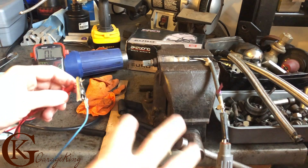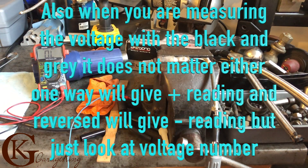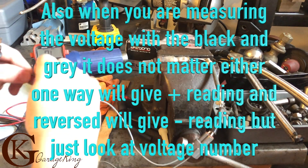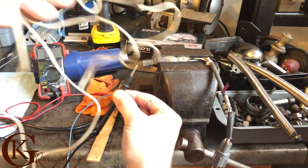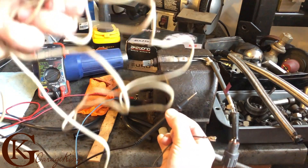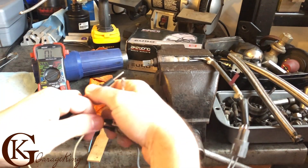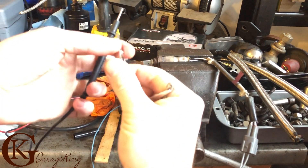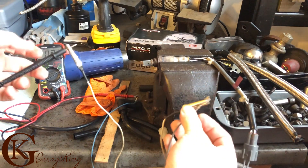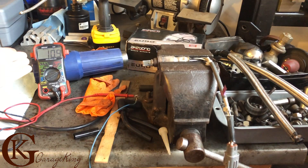When measuring the resistance of the two white wires, it doesn't matter which one's which as long as you have them both connected. I took the connector and used an alligator clip to join it. The problem is I didn't have a short alligator clip, so the long one has a little bit of resistance — that's why I sped up the video, I was fighting with it a bit. All I basically had to do was connect this part to this part, just so I wouldn't have to hold it. And there we are — right close to 11 ohms.